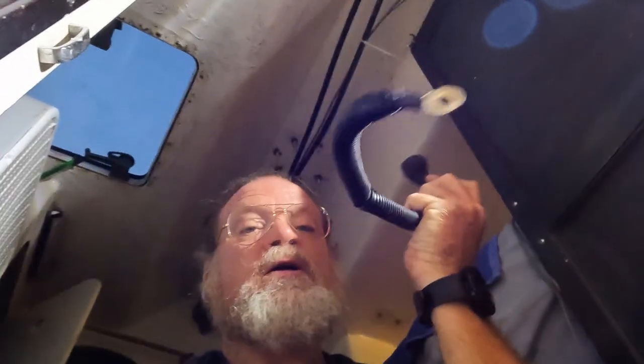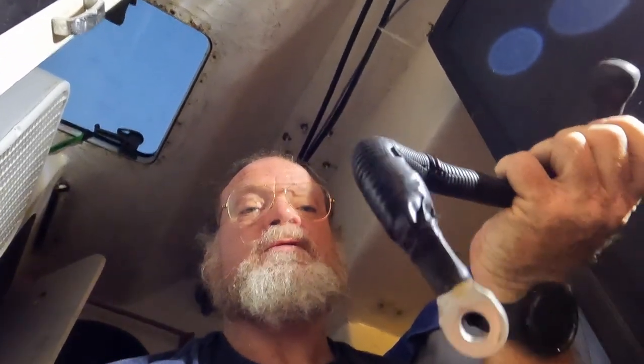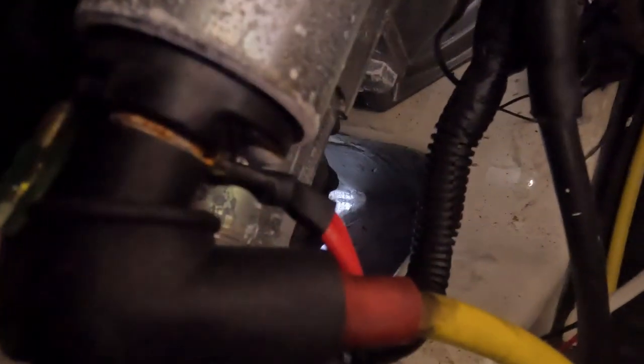This is the normal battery charge cable. It goes from the alternator — the alternator mounts right here — connected to the wiring harness that goes back that way, and then down here on the starter. On that post on the starter, you take the cover off, take the battery cable off, take the nut off, then unscrew the nut-bolt combo to get down to the bottom to take the cable off. That inner red cable is where the battery cable is connected. The piece in between is kind of a barrel nut with a bolt on it, and you have to take that all apart — it's really hard to reach and it's a little narrow space.